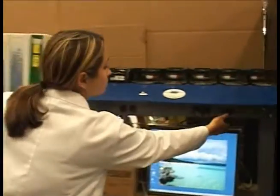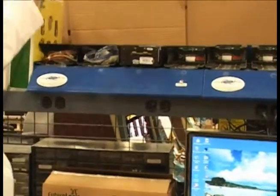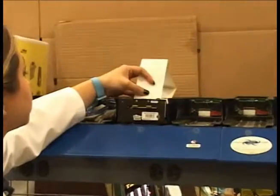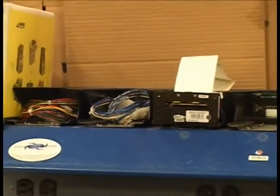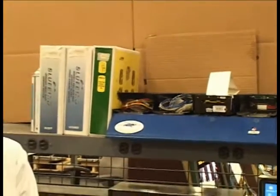First, turn on your FutureLogic Gen 1 download tool. Insert 3 thermal tickets into your printer. If your printer has not been flashed before, it will generate 1 blank ticket. Ensure that you remove this blank ticket before you initiate the download process.